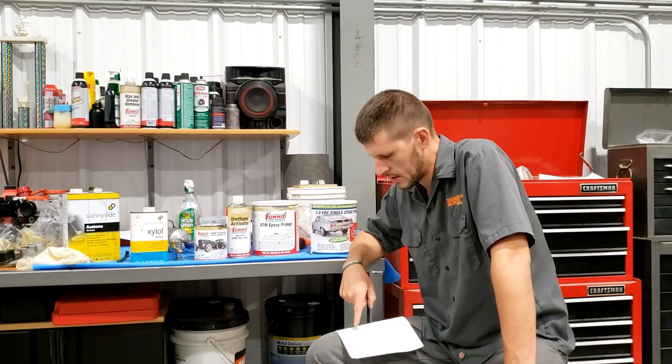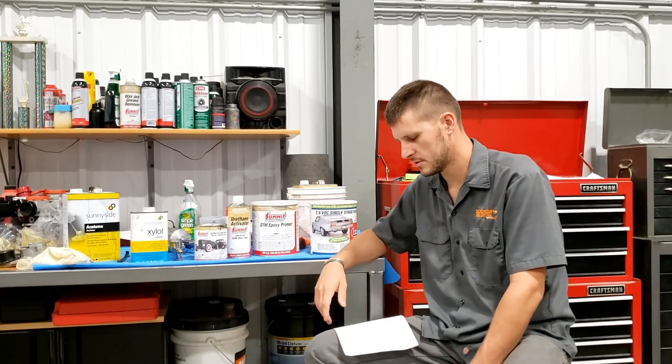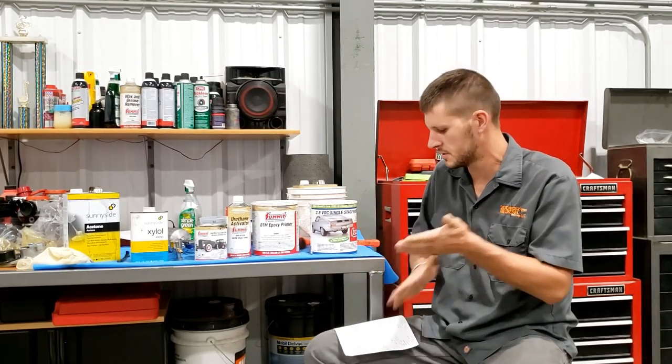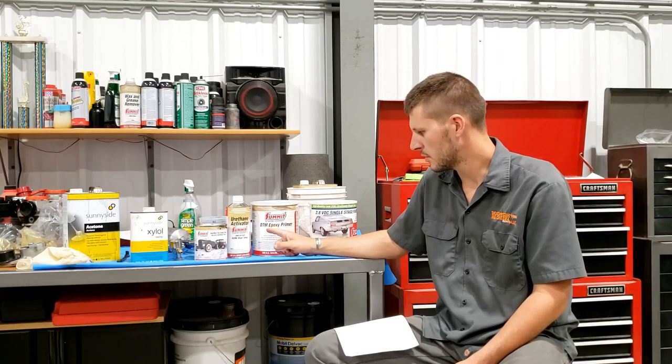So then they started talking about top coating it, and they used to have a can of primer called Ticoat, and it says it's the best intermediate coat between your POR-15 and your top coat. Well, then they changed the name of it to High Build Primer and totally just tried to wash their hands of this Ticoat idea. And so another discrepancy there was in the technical data sheet, it says you can't recoat the Ticoat until 24 hours has passed. But then on the can, there's like three bullet points. And the third bullet point says can be top coated after 30 minutes. So 30 minutes, 24 hours, huge discrepancy there.